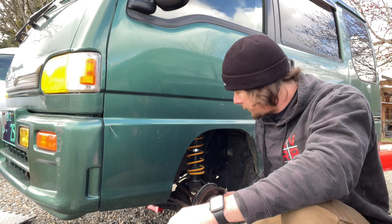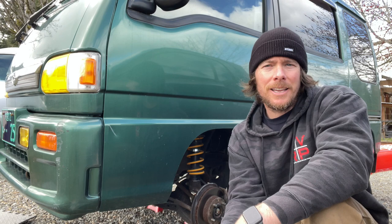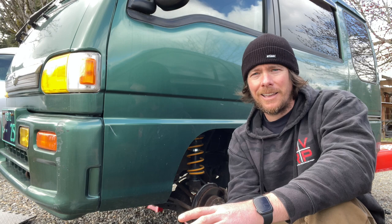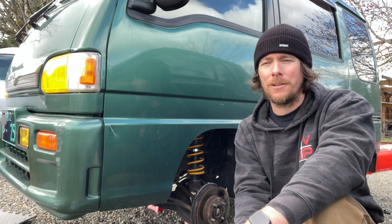since they hardly have any wear on these brake pads, I'm just gonna scuff them up and reuse them with new rotors. So I figured, hey, I'll show you how to change the rotors and give you a little forewarning that the eBay brake pads are not going to fit, and they're gonna require some grinding, just like the struts did, or the dampeners, whatever you want to call them.